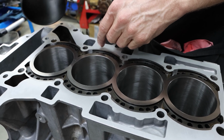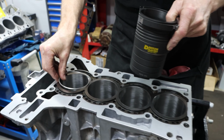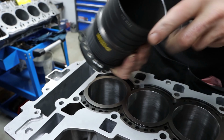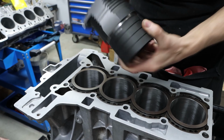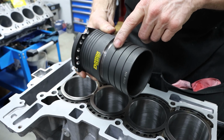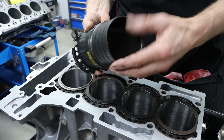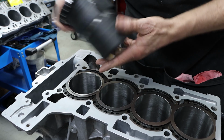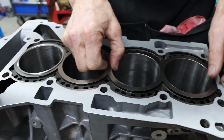And the pressure from the Cooper ring, the way that we've designed it is, the head's pulled down nice and tightly on the Cooper ring, and that force is going straight down to the bottom on this balcony seat here, which is the machined surface at the bottom of the bore. So it's a nice vertical, positive, broad seat contact area in the bottom here. And there you can see our 3 grooves for our sealing O-rings to separate the coolant area from the oil-wetted area in the bottom. You can see it's quite a rigid, thick, solid assembly. We've designed it so that we're getting minimal clearance between the liners, so we're keeping those clearances there nice and tight all the way through.